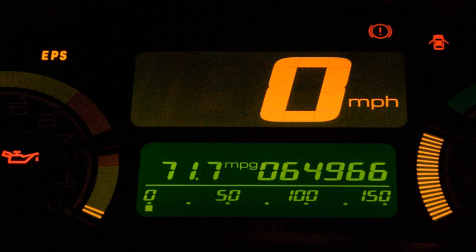As the part in question turns, the magnets or teeth pass beneath the sensor, each time producing a pulse in the sensor as they affect the strength of the magnetic field it is measuring. Alternatively, particularly in vehicles with multiplex wiring, some manufacturers use the pulses coming from the ABS wheel sensors which communicate to the instrument panel via the CAN bus. Most modern electronic speedometers have the additional ability over the eddy current type to show the vehicle speed when moving in reverse gear.